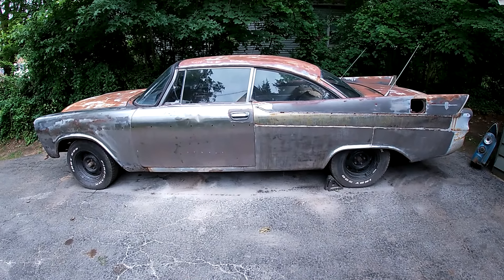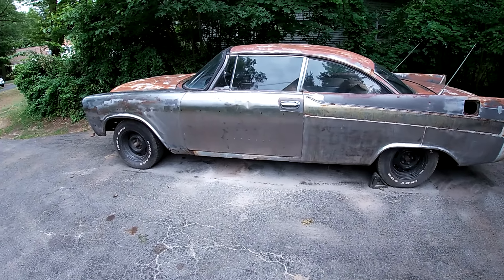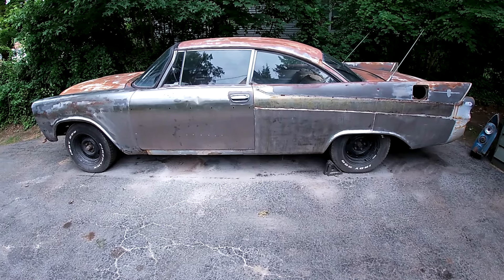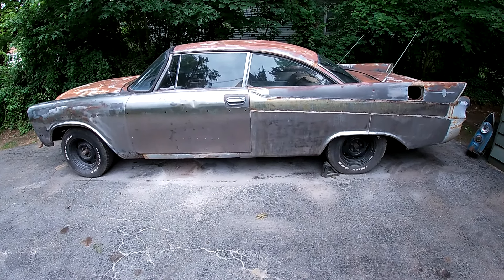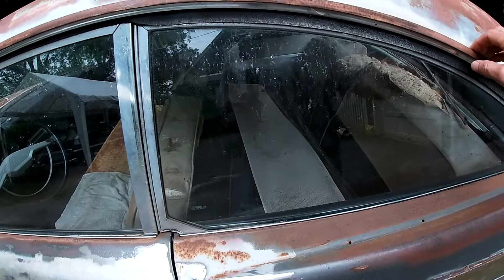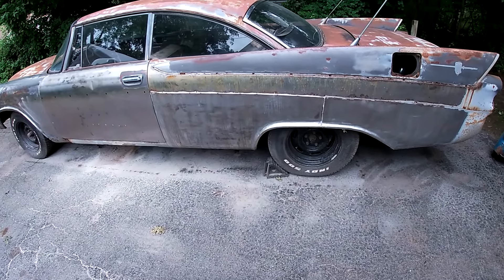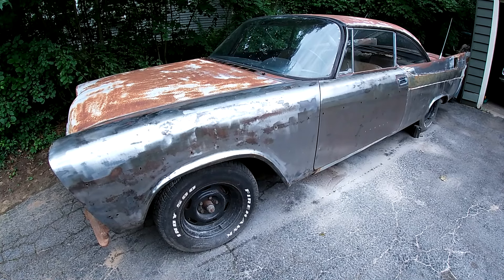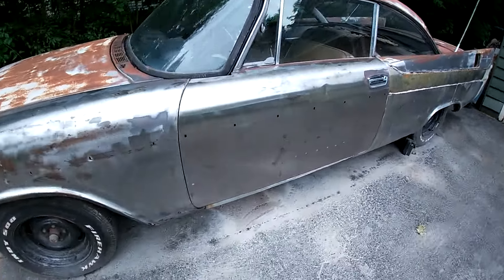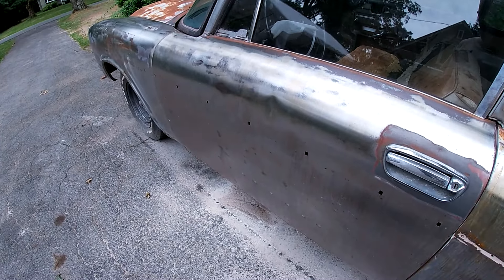This car has been out in the rain for a week, raining on and off, and that is the total surface rust that is on this car. I started with the front fender, door, quarter — and the quarter seems to be rusting the most, but all in all I'm okay with it. Once I get through this stage, I'll come back and sand it, do all the finish work, get right up to the windows and all this stuff. Then I'll come back and wash it, put some rust converter on it, prime it, and then paint it. I bragged to everyone that the goal for this car was to fix the rust but not the dents, and I have a reason for that — although I do kind of want to see if I can pop this one dent out in the door. That one kind of bothers me.